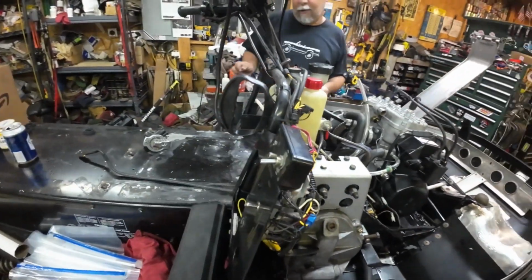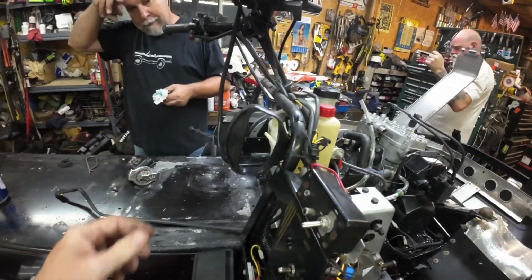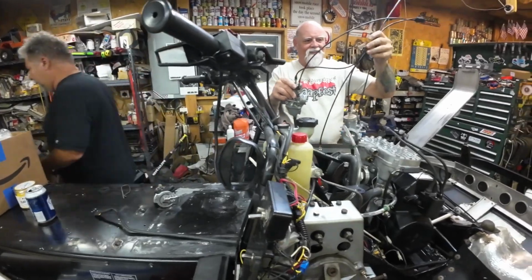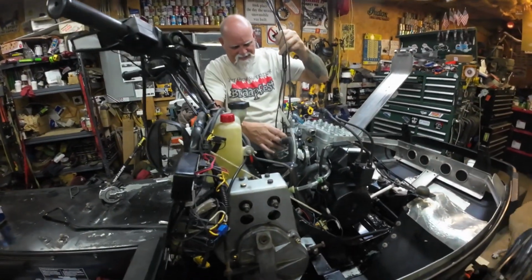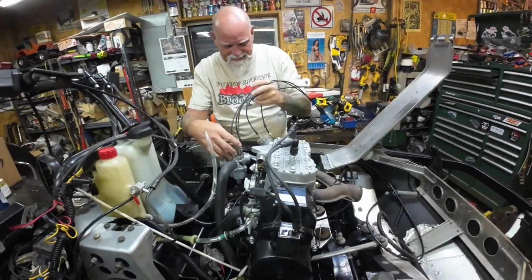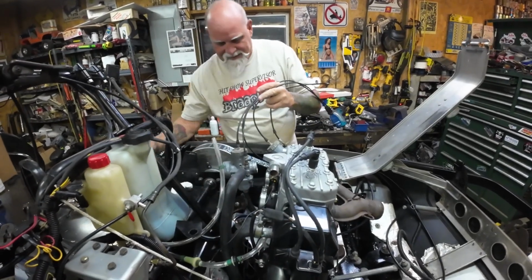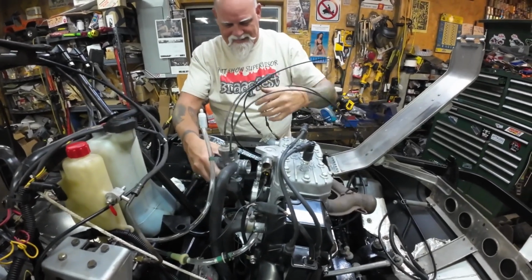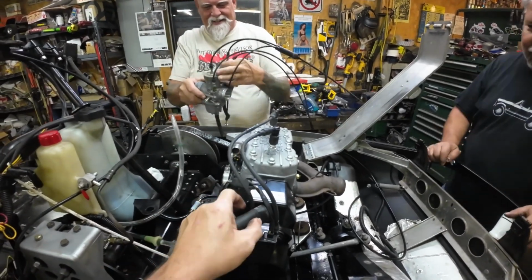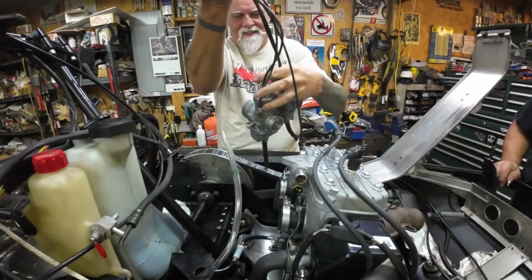Plumbing to do. Not sure why you need this. I'll need it until my electric start parts get installed. That's what I'm saying. He needs that in case the battery goes dead. It'll still run. The ignition system does not involve the battery in any way on this snowmobile.